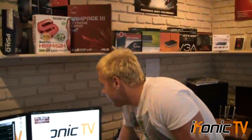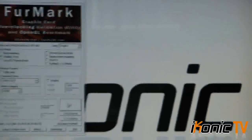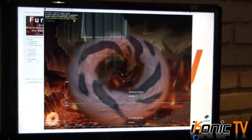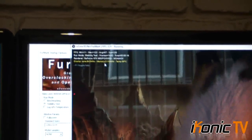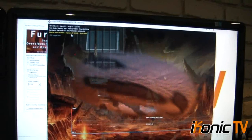The program we're going to use here is Furmark, which will monitor how hard the card is working under stress. We're going to run a quick stability test — press go and drag this across. Your temperature will show here and your card's current speed will be up there. This pushes your card to its limits, so if it's not running optimally you'll get artifacts — little lines across the screen or odd dots. As you can see, we're not seeing any signs of artifacts or freezing, which means the overclock is stable.